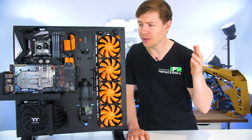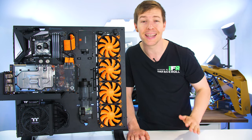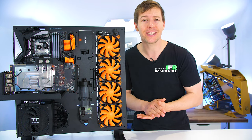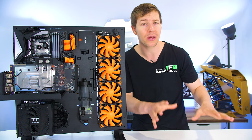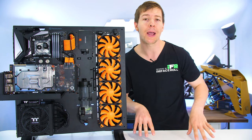So now I've had to throw in some Thermaltake fittings just to account for the extra bends needed for this system. If I didn't just stick to the 90 degree bends and we screw up one of these tube bends, I have no 14 millimeter tubes left, so the system won't be able to be complete.